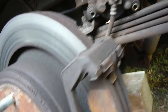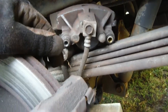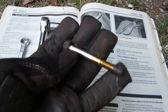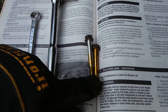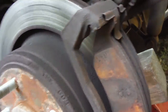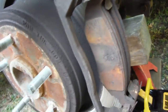And just like that, caliper is removed. They always tell you to get some kind of coat hanger or something like that and hang the caliper, because it will dangle and you don't want to break your line. But fortunately for me, mine sits perfectly right here on top of my leaf springs, so I don't really have to worry about that. These are the bolts that came out of it. It's literally two bolts that make you stop. There's discoloration on half of this one and all of this one — I'm thinking that's because it was overheating whenever the caliper locked up. Now that we pulled that off, it just sits right in here like so, and you just pop it right off. If you use that C-clamp, it will just come right off, nice and easy.